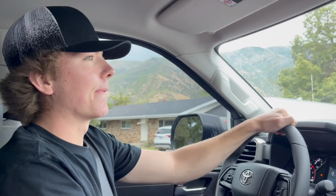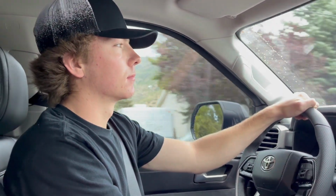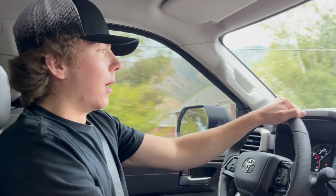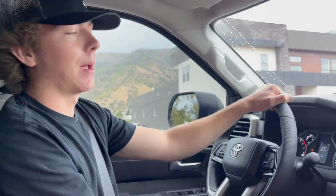So just use map 2 basically? We're going to use map 3 too. It'll be fine, he said. And then it just what, pulls timing or something? The ECU knows how to pull timing, so it'll just do that? Well, I think it just ups the boost, and so it does everything automatically. Well, yeah, but if map 3 is tuned for 93 octane, then it'll pull timing. Above map 3, you'll need higher octane.